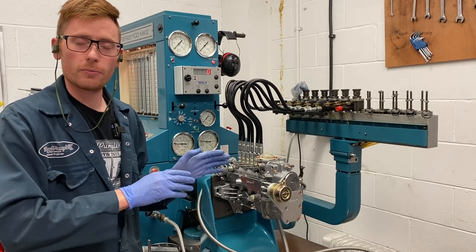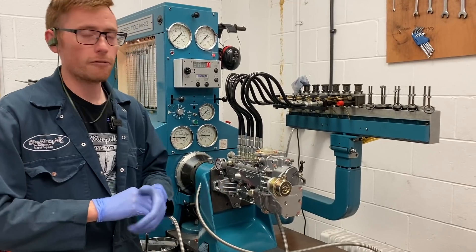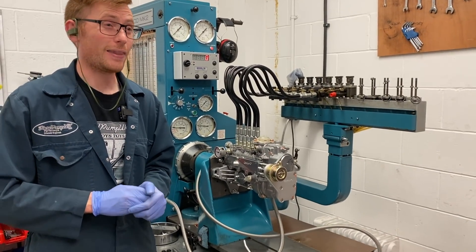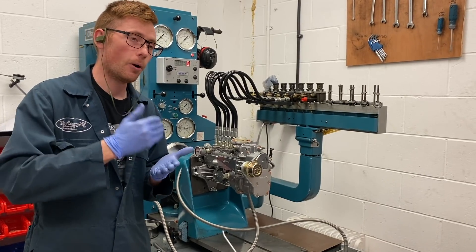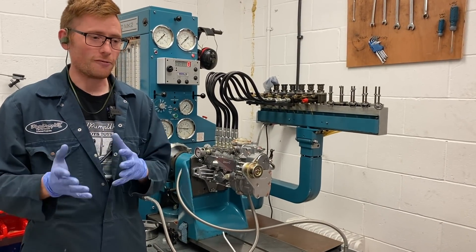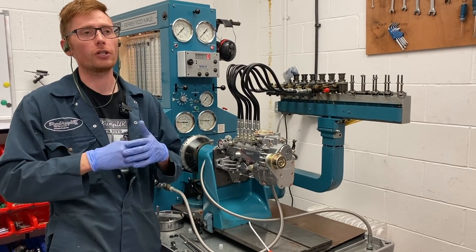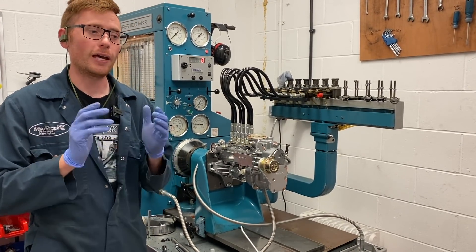Because of the disagreement we had with a Swedish gentleman, the German chap Tomnick contacted us and said he wasn't that man's biggest fan because he'd been ripped off, and asked if we'd be able to produce his elements, as he'd love to work with someone no longer affiliated with him. I said at the end of the day I've used your 8.5s and they were amazing — all the time I was working with that Swedish company, I was chasing and chasing to get a pump as good as the 8.5. The amazing fuel consumption matched with massive power delivery, and not needing a lot of fuel pressure — they are amazing. The issue is they're not particularly easy to manufacture because they have a fairly thin wall, so you've got to use a high grade of material. But after all the effort we put in getting them done and into the pumps, it was well worth it. They are more expensive, but wow.